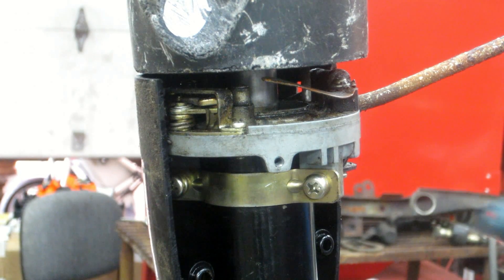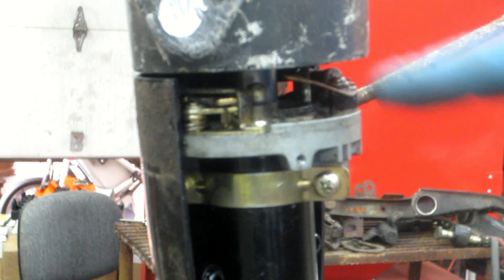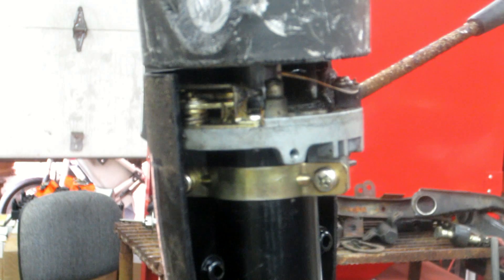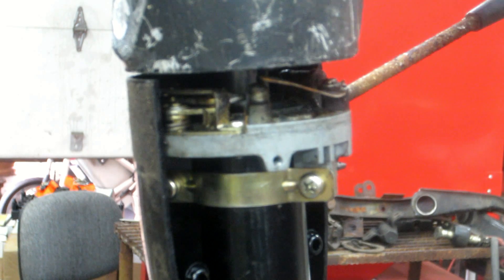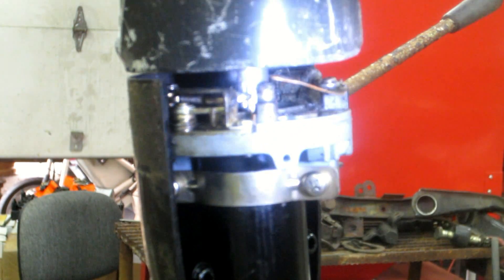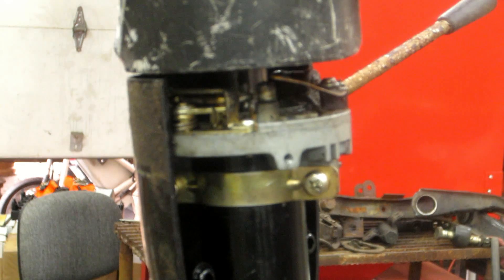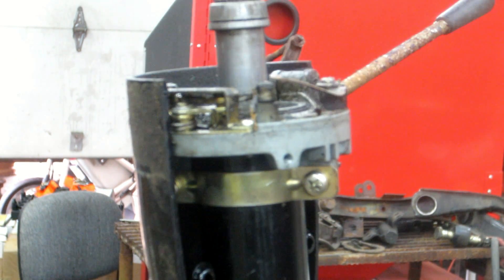What I did here was put the screw back in the pin, loosen the clamp back up, and slid it all the way up. So you can see we've got a nice narrow gap here with the 521. You also notice our spring's not touching, so the horn wouldn't work at all. But let's click a blinker on - see how that popped back off, and the other way - that pin just popped it right off. The pins are engaging just fine. You can see the pin inside there and it's way down far enough to be engaged without any problem. The biggest issue is the 620 adapter is not tapered and will not go down over those cones.